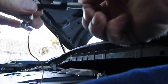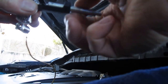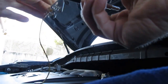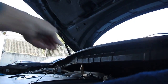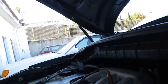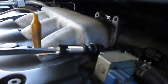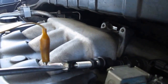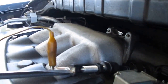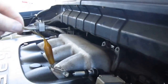So now I'm going to drop it down to 10 kV. There are little increments marked off on the inside of the tool to tell you where you're at. At 10 kV we do have a spark, but it's very weak and very dim. It should be making all kinds of noise and sparking through there, so we know that coil is pretty weak from the way it's behaving.